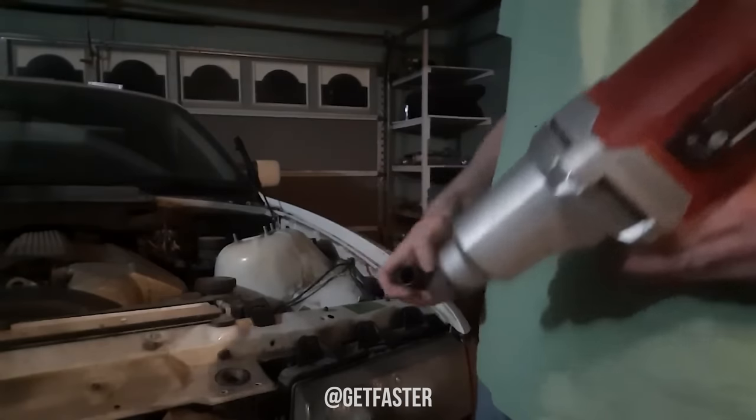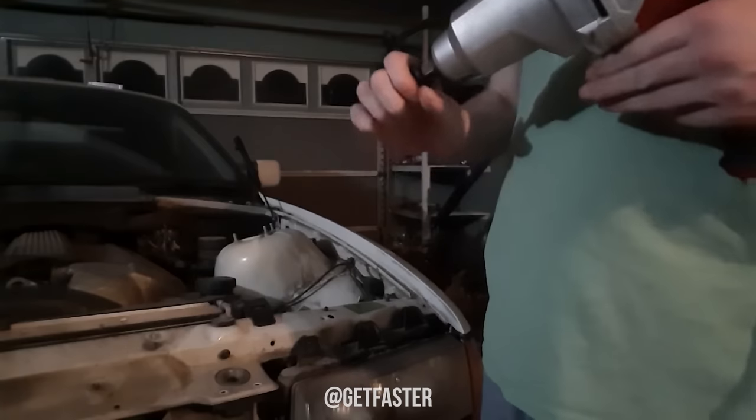Once the assembly is done and you do the necessary torque specs for whatever you're installing, you're then gonna wanna make sure that the bolts and washers that you're putting back on the car are also good to use and can handle that new torque spec. Sometimes there are crusher washers that can only be used once. You need to go get another one. I know it sucks, but you're gonna need to. So check that stuff out. Sometimes, just sometimes, you can't ugga-dugga the heck out of that 22-year-old bolt. Either these bolts are gonna strip, these screws are gonna strip, or they're gonna come out.